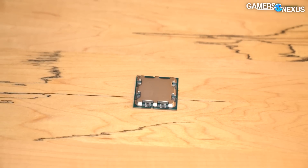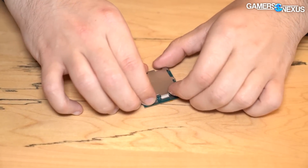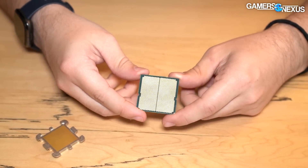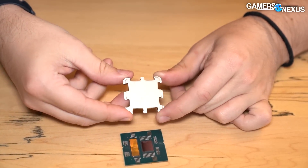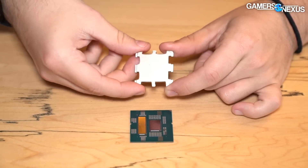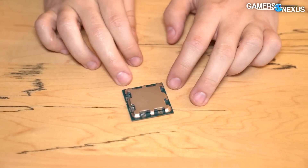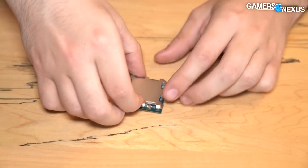And so this is how you end up with this eight-legged design, like the one we're looking at here. Another thing you could do to work around this — with the Intel approach — would be to increase the pin density. Increasing the pin density is a bit of a different challenge because then you're putting a lot more pins in a smaller area, and that's not necessarily easy to do. So this was AMD's way out, and it's got some benefits. One of them is that because the IHS is able to maintain this smaller square size, it allows for wider cooler compatibility. Since it's closer to what we're used to, existing coolers will fit on this pretty cleanly, and the motherboards are backwards compatible with older coolers as long as you buy the mounting kits.